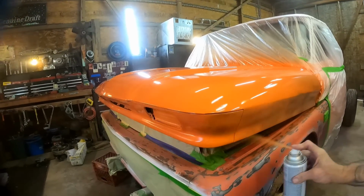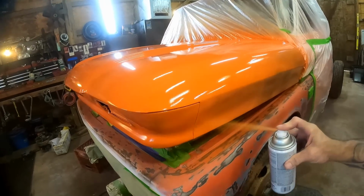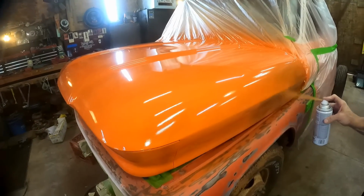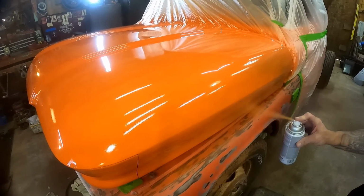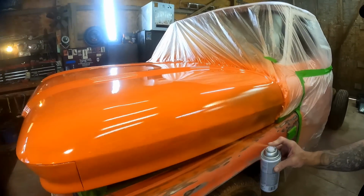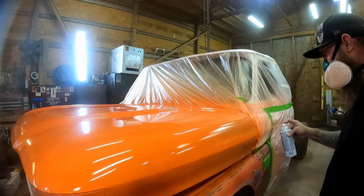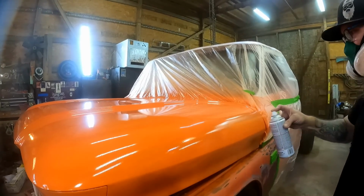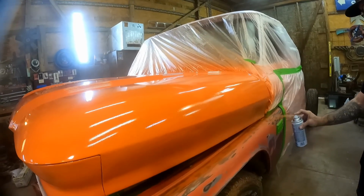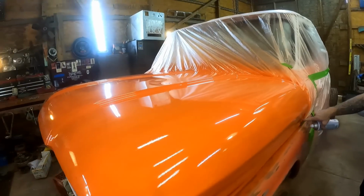Switching over to one of my empties to do a horizontal area. That's one of the best tricks I could tell you guys. I mean, I'm sure it's just common sense, but I know, man, there's somebody out there that's going to throw this can of paint in the trash just because they can't get it to spray out on that horizontal area. And all they had to do is just save it for the vertical areas. Look at all that extra paint we're getting. That is going to save us every bit of a can or two on this overall job, which is good.